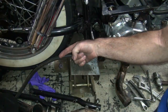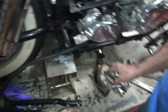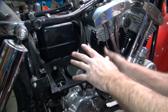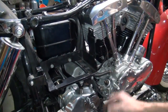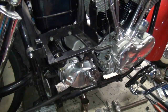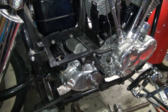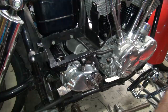As long as you blow it straight back or slightly to an angle out it won't get all over your bike — underneath the bike will stay dry. If you just blow it right down here it blows all over the whole bike underneath and also comes up to get all over the oil tank. It just goes in a big circle under the bike. So if you want to keep the oil off the bike, get the puke line away from the bike — that's why you make it real long going that way. Figure out the exhaust system next. Let me clean up a little bit and I'll be right back.